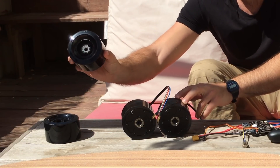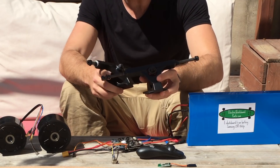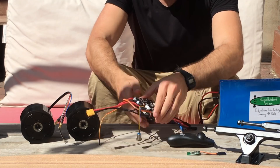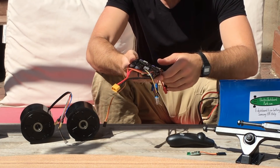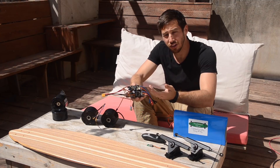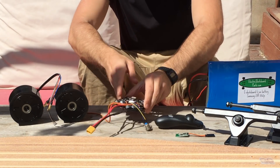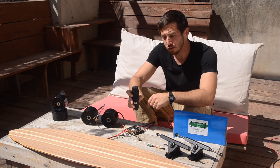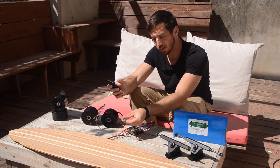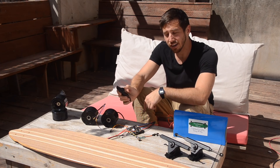Then I've got two standard 90-millimeter longboard wheels. Next, we've got our trucks — the rear trucks have a longer axle where the hub motor is going to go, and the front trucks have a shorter axle for just the standard longboard wheels. Next, we have our dual electronic speed controller, or dual ESC. This is two controllers basically wired together so they share the same remote or throttle. Each one runs one of the two motors because you can't run two motors off of one controller. And then lastly, we have the remote or transmitter — the throttle of the skateboard — which connects via this receiver right into the dual ESC, giving us throttle and braking.